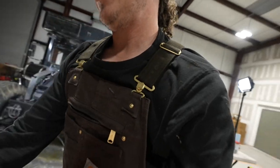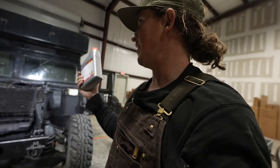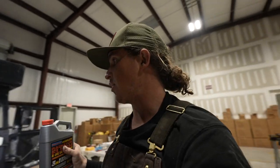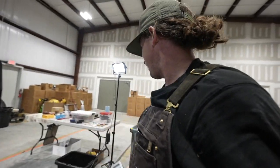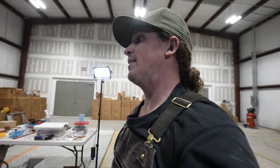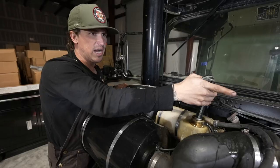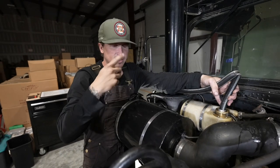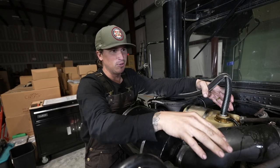So I'm going to add the radiator flush stuff we have — it's called Blue Devil Complete. I'm going to run that through the system and then add water on top of it. Then we're going to go get some tacos, and once we get back we'll drain the system, take a sample, and see where we're at. If it's looking better, I've got a couple gallons of Prestone, so we'll run another full system through it — maybe run it for a day or two, drain it again, and keep going. It's a little bit of a process, but it definitely needs to happen on a vehicle that's over 30 years old. I also took the thermostat out so the system will just continually flush and run without hitting a threshold until the system is fully clean, and then I'll put it back in.